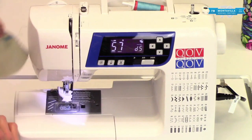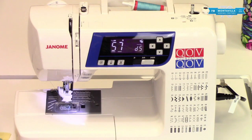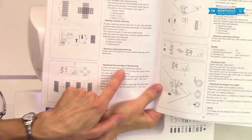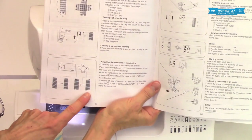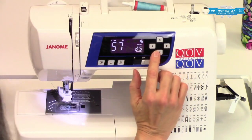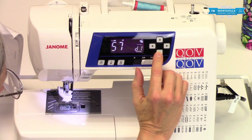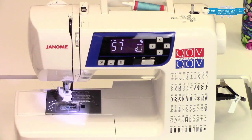One thing I noticed — see how that's going uphill like that? We want to correct that. Here in the book it shows you at the bottom how to adjust the evenness of the darning. That one's tending to go uphill, which means we want to press the down button. So let's move the cursor over onto where it says D5 and press the down button. It goes all the way up to nine.